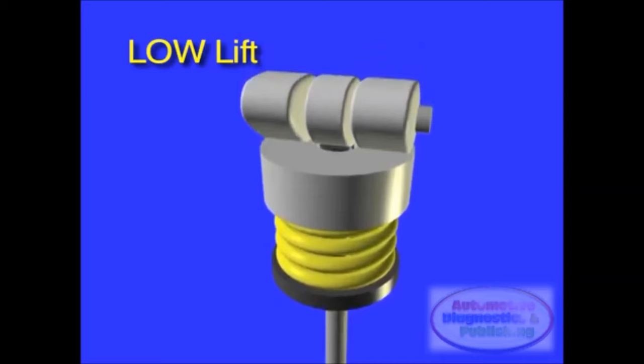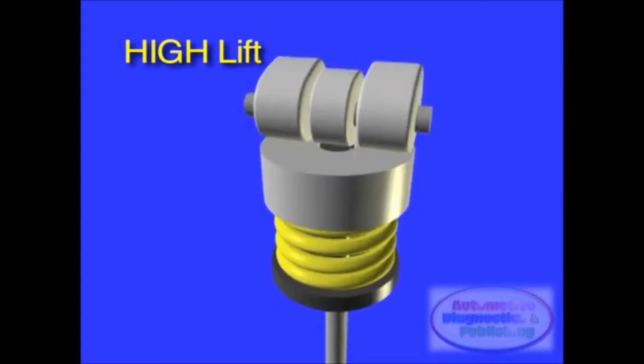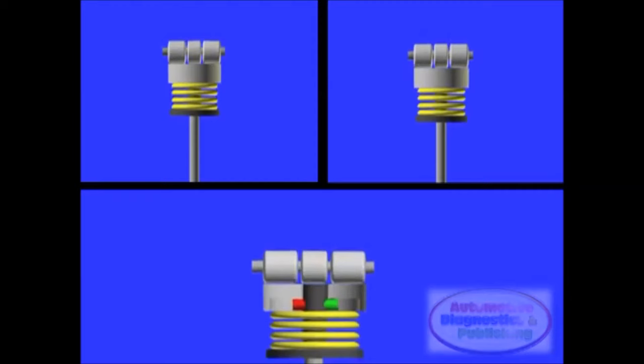The variable lift mechanism is unusually simple, and saves a lot of space. The variable tappets are just slightly heavier than ordinary tappets, and require not much more space to operate. With an automatic chain tensioner and hydraulic valve lash compensation, Variocam alters camshaft timing for greater engine torque. Since there are effectively two cam schemes on each intake camshaft, it is possible to apply two different valve lift curves. The phase angle, or timing, on each of the cams can be advanced or retarded using an electrohydraulically actuated adjuster. Variocam Plus offers a number of benefits when starting the engine from cold.